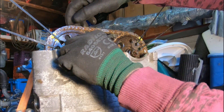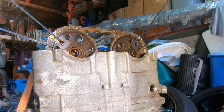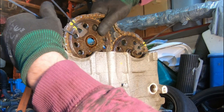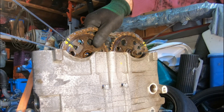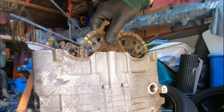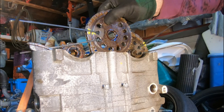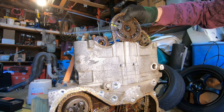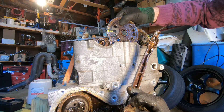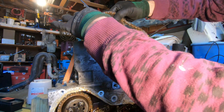Let's take this bolt out. Bolt is out. Pull the cam gear forward. At this point we're able to move some of the chain. We're going to pull out the cam guide from the top if we can. Looks like we can't — we got it from the bottom. So this is the other cam guide, and this one looks like it's doing great. Let's try to take off this whole assembly.